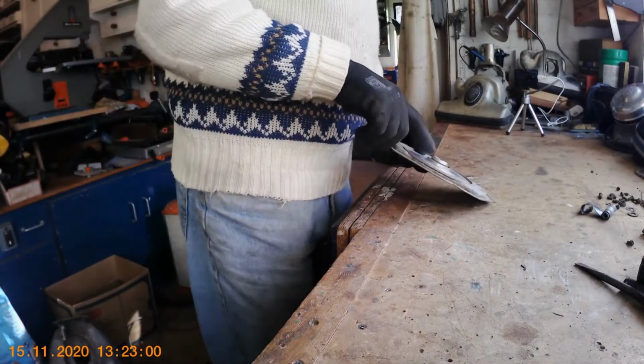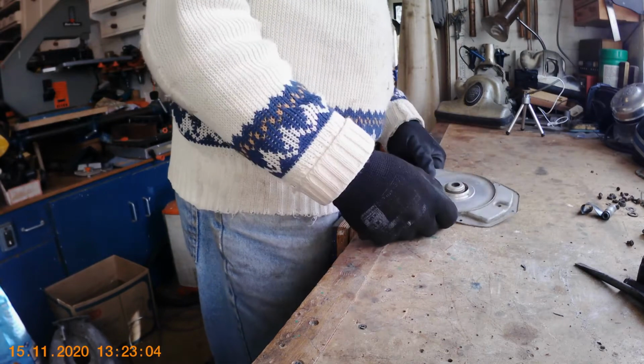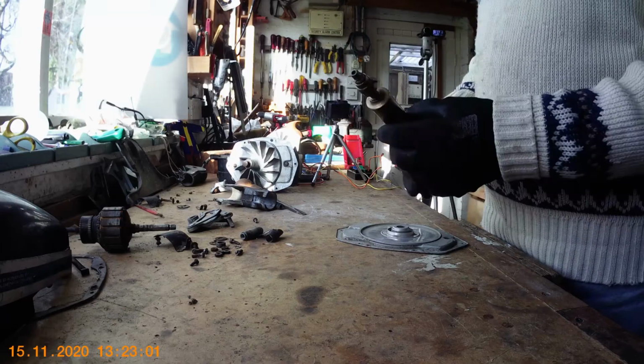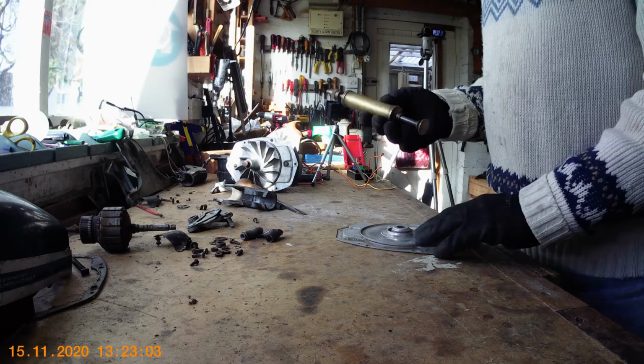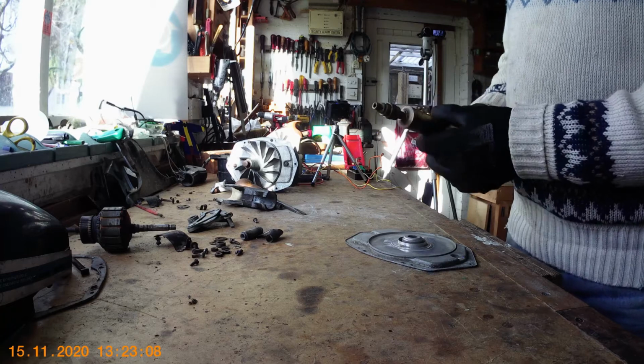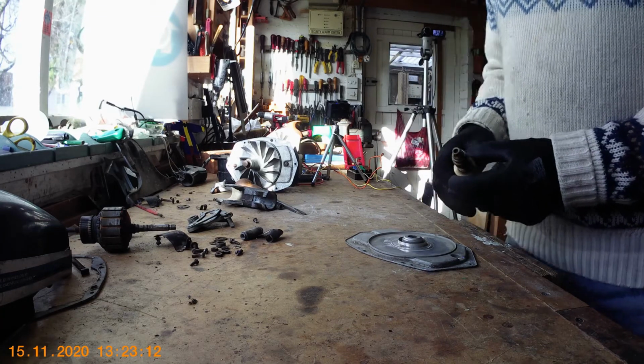If you need to grease the bottom bearing, which is a ball bearing, you've got 2 options. The correct way is to use a proper Hoover grease gun, but I doubt many people have these. They're only issued to Hoover dealers originally. They do come up on eBay from time to time. It's the only real way you can grease a Hoover bearing that's encapsulated.